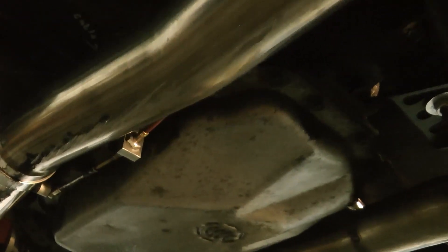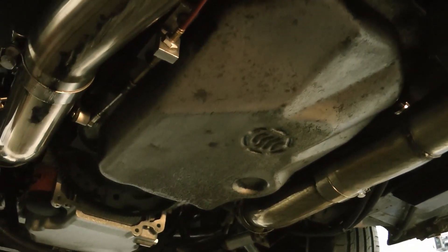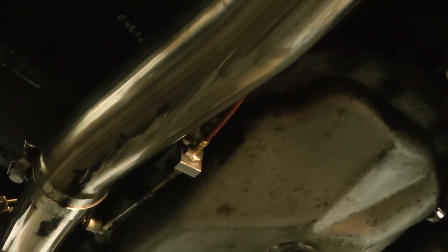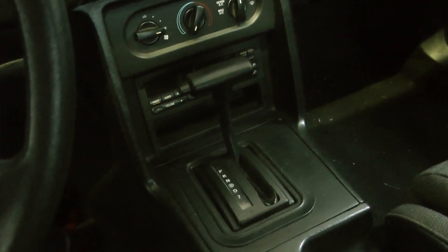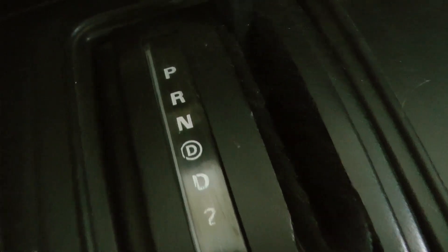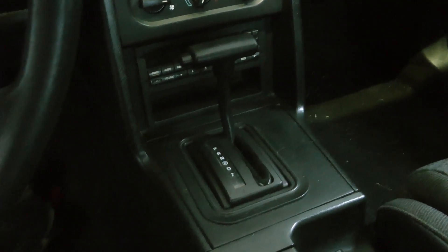Here's the transmission — it's a 4L80E and it does fit in the car, though it's very tight. The shifter cable runs back up inside the car, and I'm using the stock shifter. Inside the car, you get a completely bone-stock look. I'm using the four-cylinder shifter, which has four gear selections that line up perfectly with the 4L80E. Check out my dedicated transmission video — I did have to modify it, it's not perfect, but it works well.